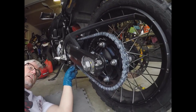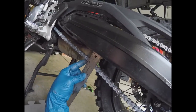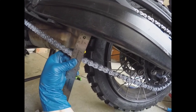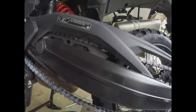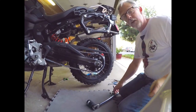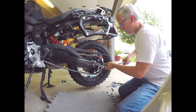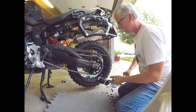I loosened up the tightening nut by half a turn. Coming back here — pressing up I'm at 28mm now, and on the downside I'm at 23.5mm, so that'd be 44-45mm of movement. It says 40 to 50, so I'm in the zone. Final bit is just to tighten down the rear axle nut — that spec is 100 Newton meters. It's a monster 34 millimeter nut. And there it is. Thank you.